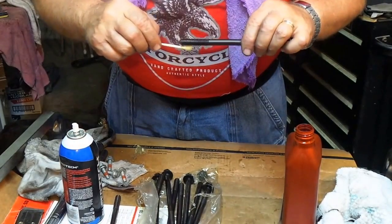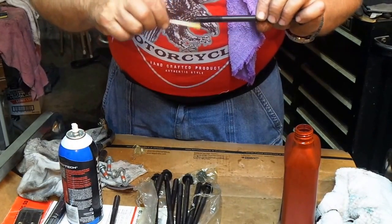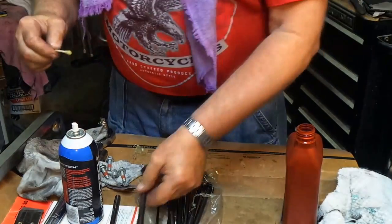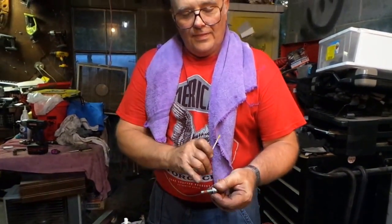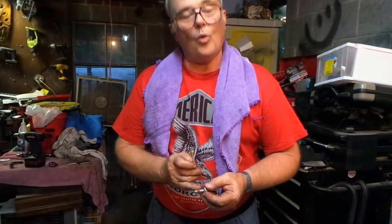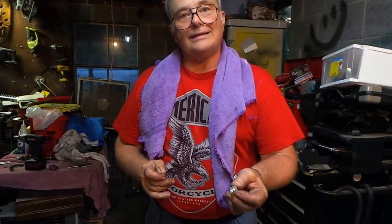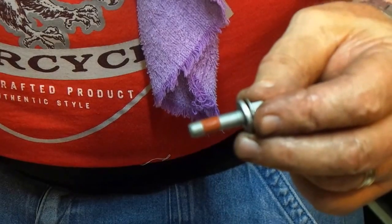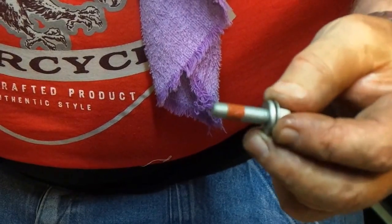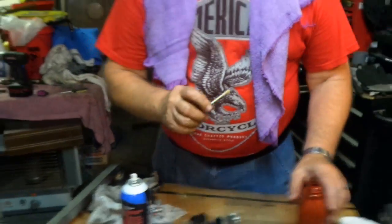You don't want to soak them; you just want them lightly oiled. On the smaller head bolts, they suggest putting a seal on them because water will leak out of those holes — they enter a water jacket. But if you buy them new, they already come with the sealant applied, as you can see here. You do not lube those smaller bolts.